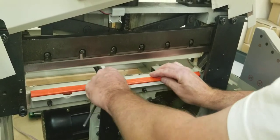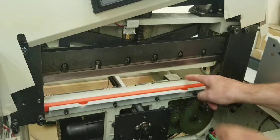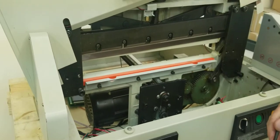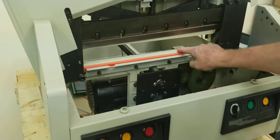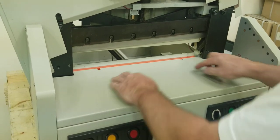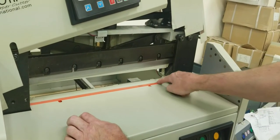I'm just going to put this back in where it was since it wasn't used much. Make sure it's slid all the way to the left and pushed up against there, and make sure it's all the way pushed down so paper slides over it smoothly. Hold it down as you tighten the screws, going back and forth to make sure they're all really nice and tight. Then slide the table back into place — pop it in with the palm of your hand, flush against the surface. Make sure the table is not higher than the pad; it should be flush with the pad or just a hair below it.